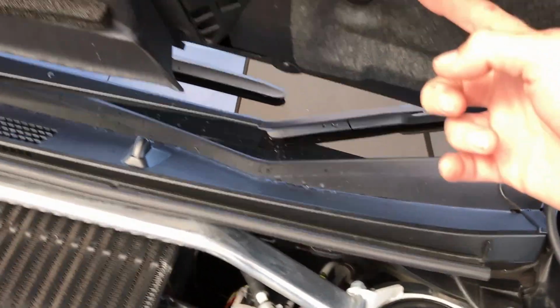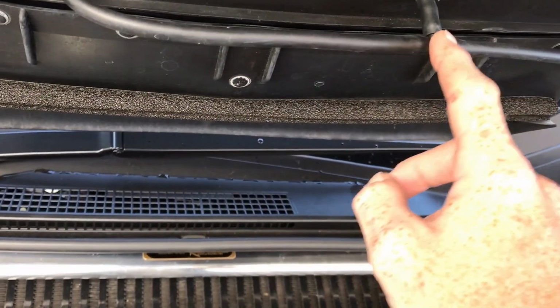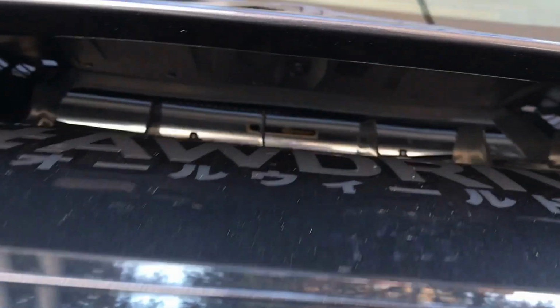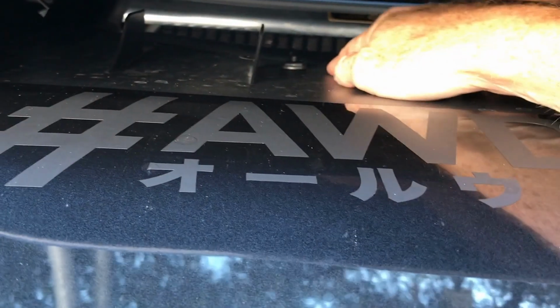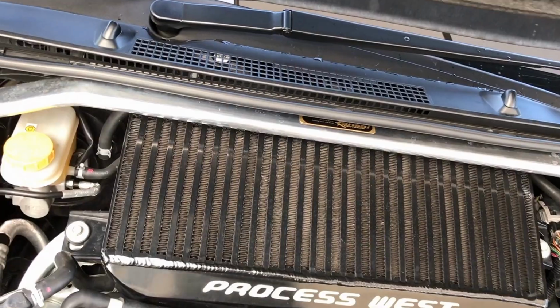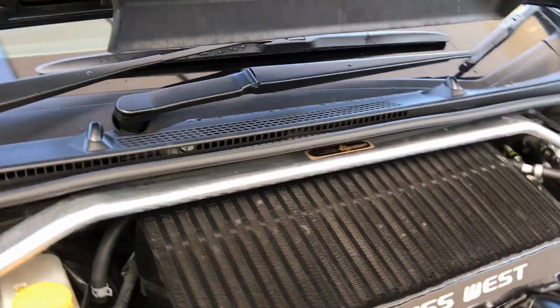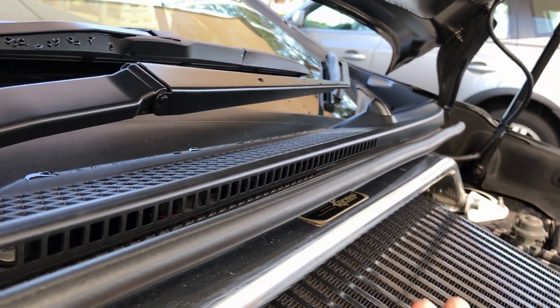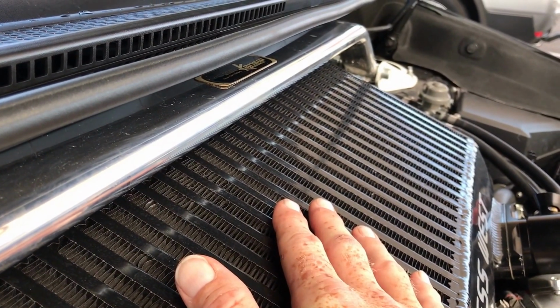That line runs behind the hood liner here, and goes into this, and right in here, facing in an upwards direction, into my engine. You'll see this one little nozzle here, and another little nozzle just there. That sprays an atomized mixture of air and water into this cavity in the hood vent, in the hood scoop. So that means that the air coming out of here, which is ultimately passing through this intercooler, has now charged full of atomized or misted water.